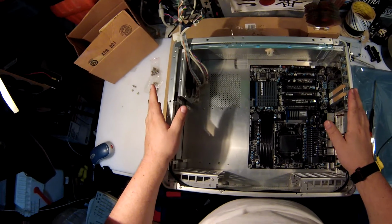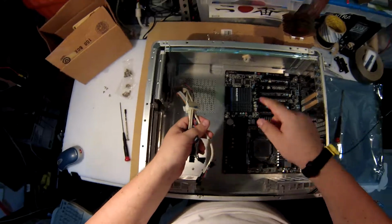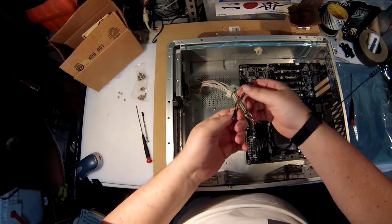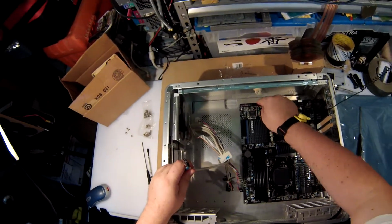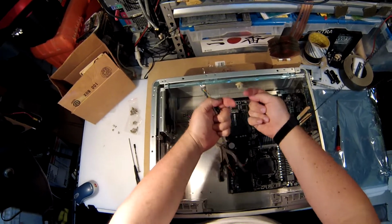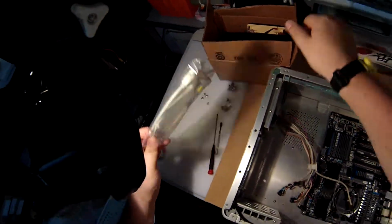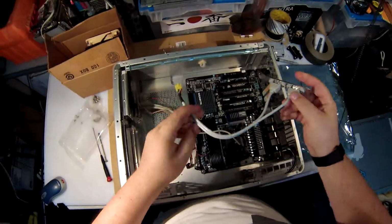Step 2. I guess I should do these next. Now, this has a USB 3 front header, but this case, as sold, doesn't have one. And USB 2 and 3 are not compatible. There's actually more pins in a USB 3. But you can buy an adapter you plug into this, and it gives you literally just 2 USB 3 females internally, and then you could run something like this thing that I'm crushing. Just like one of these. Right in the back.